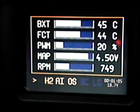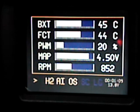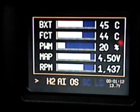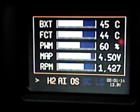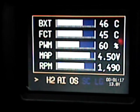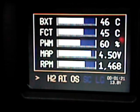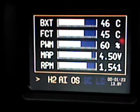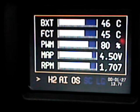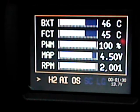I'll demonstrate here — at the bottom you'll see the RPM. As the RPM goes up, you'll notice that the PWM will increase its duty cycle. So there's 1,300 RPM, 1,400 RPM — we get 60% duty cycle, where it was down at 20 at idle. We'll rev it up just a little bit more. We'll hit 1,500 RPM, it should go to 80. There it goes to 80%. And anything above 1,800 RPM will take you to 100%.